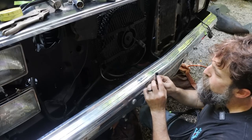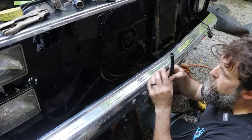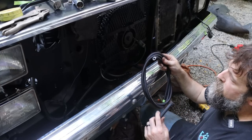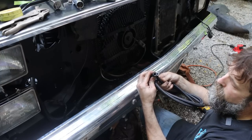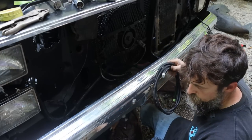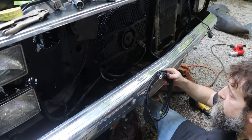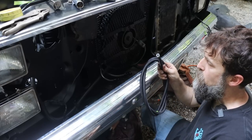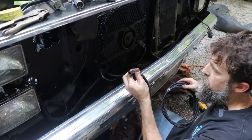Now on the other truck I used, I believe this is HDPE, not for sure. It's a little bit cheaper, a lot more flexible line than the Teflon stuff. It's just rubber line, a little bit smaller in diameter, same ID. So the Teflon is a more expensive hose, but it will definitely hold up a lot longer. The fittings also take different fittings. You can see they're two different size lines. These take a ferrule fitting that's quite a bit harder to put on. This is tougher to mess with than this stuff here.